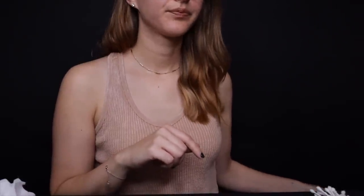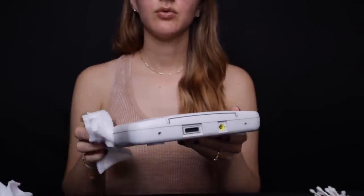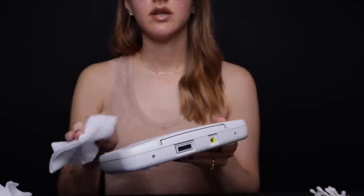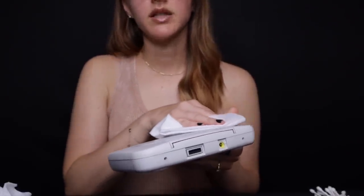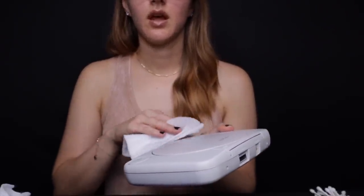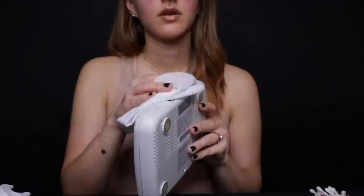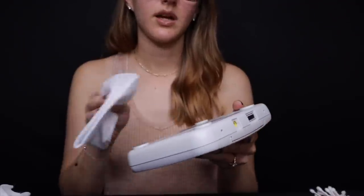I think I'm going to clean the consoles first and then move on to the games. So we have a PS1 and I can see right away that it is very dusty. I'm just going to dust it. And I forgot to mention — if you ever have any issues with Game Boys, I can replace buttons and screens if needed, so you can always bring them in. Also, when you are cleaning the contacts in a game, like inside the Pokémon Red game, you just want to get the cotton swab a little bit wet but nothing too crazy — you don't want to soak it or it could damage it.